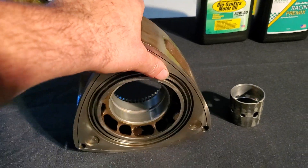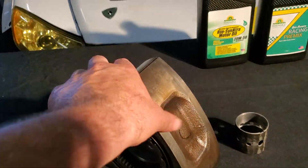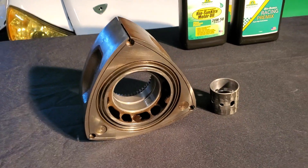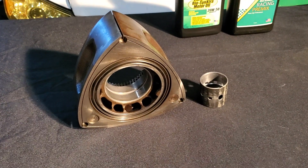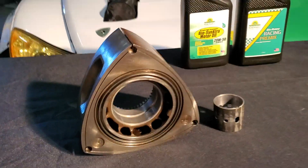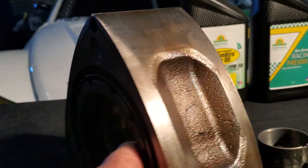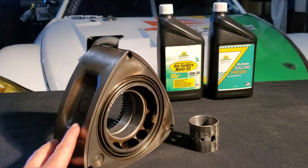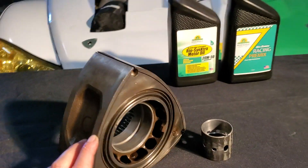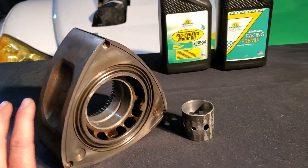These are high-compression Series 4 rotors — one of my favorite rotors: cheap, easy to find, good compression, makes horsepower, and very durable. This has been a KMR tech talk looking at the inside components of my 20B race competition motor. We had it out due to some recent events. I did end up not putting this rotor back in because we actually found one cracked corner seal, and things were looking like they could have been better. We're going to cover more components and talk more about the internals over the next week or so before Irwindale.